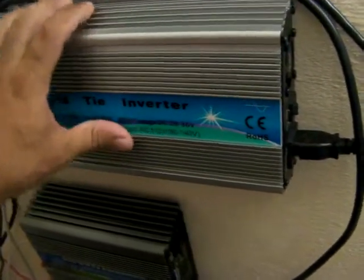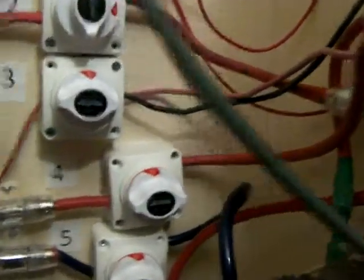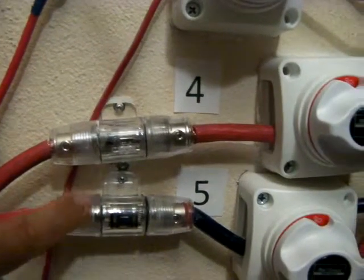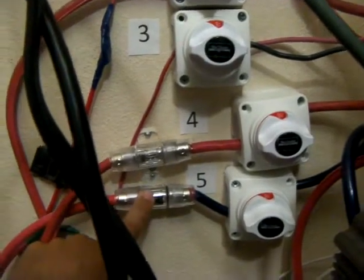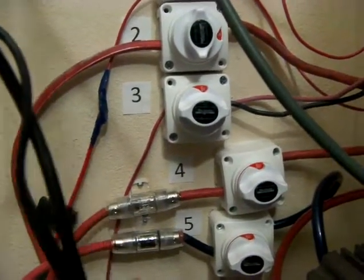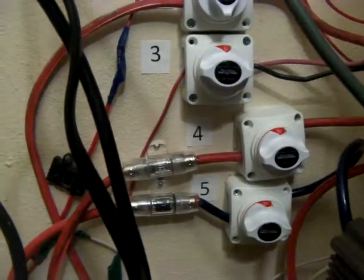I'm running them at around 50% so I don't think heat is going to be an issue, but I like to take care of my equipment. Let me show you my Five Ocean switches — they're like the Blue Sea switches but a different brand. I also added ANL fuses: this is an 80 amp for my Intronics, and this is a 300 amp for my 5,000 watt inverter, which is good for around 3,600 watts.